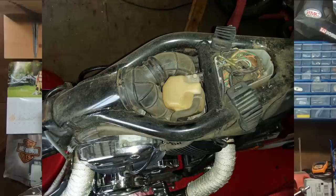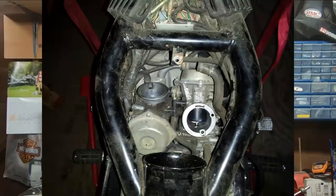Harley-Davidson with the single carburetor basically means you don't have the dual carb setup to feed both cylinders, which is buried underneath the gas tank. So basically you pretty much have to remove the gas tank, dig for those carburetors, then you got to fish them out of there. And not to mention, you also got to sync them as well.